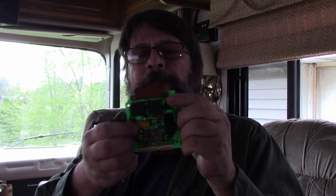And here he found out there was a bad resistor on this board. That one end was corroded off a little bit. So he proved it out. He soldered a little wire and jumped that bad spot. And sure enough, the generator started every time.